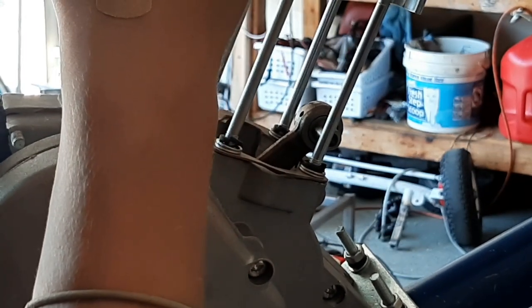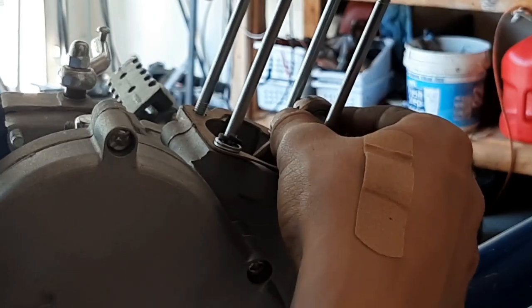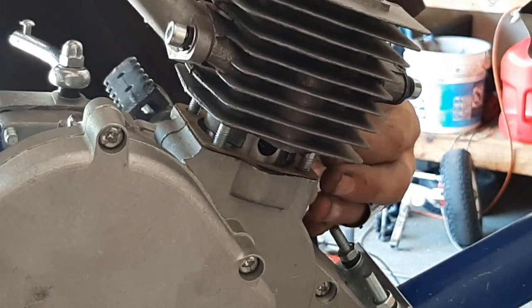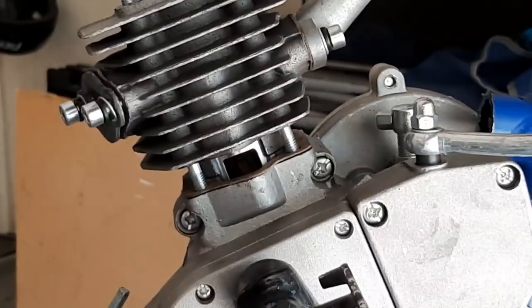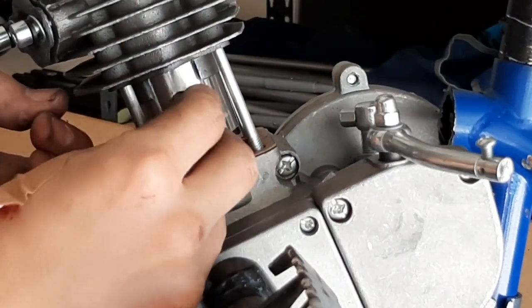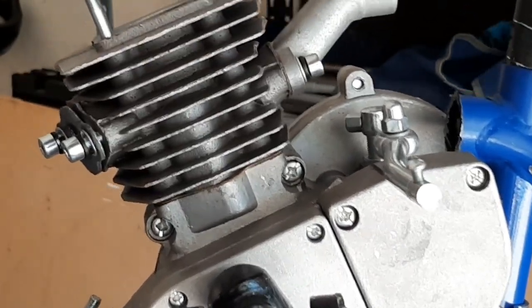This is the air intake. You're gonna wanna have it facing towards your seat. I raised my seat a few inches just to make sure it fits. Slide the wrist pin out. Slide it down there, make sure everything lines up. You can just fit the connecting rod in. You gotta fit this little thing right in there. Push it in as far as it'll go, and you should hear a little audible click. And now you can slide that down.